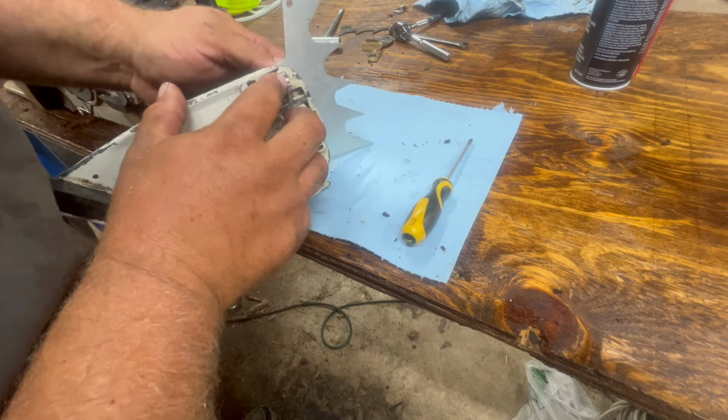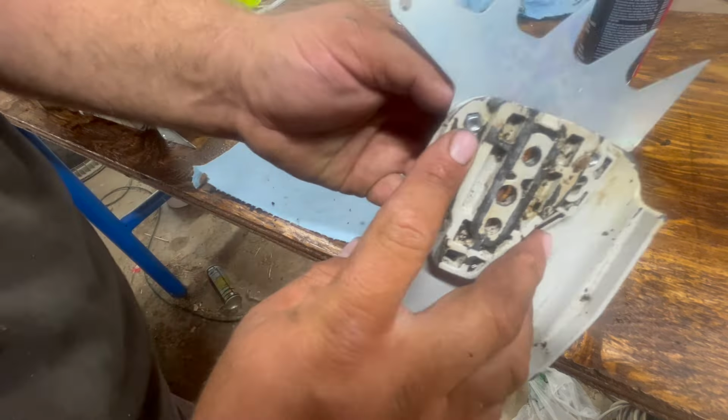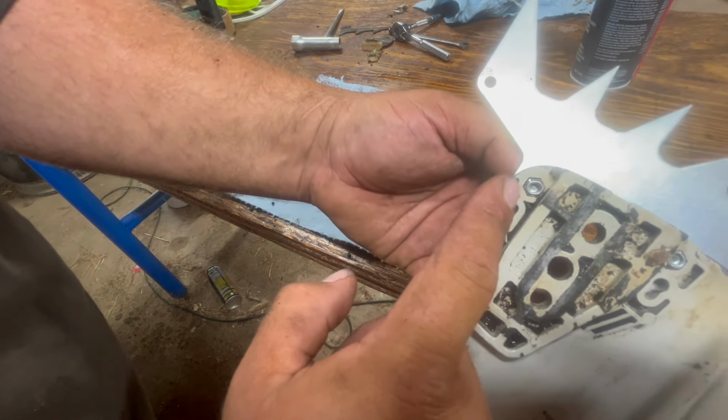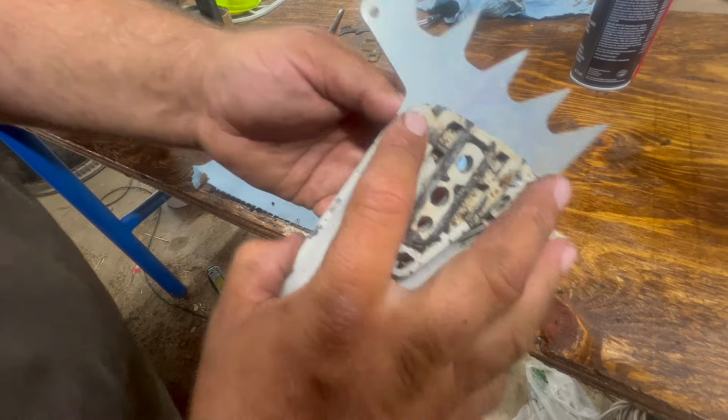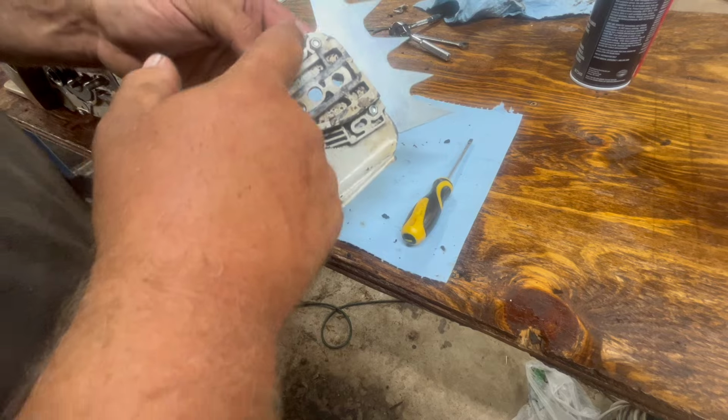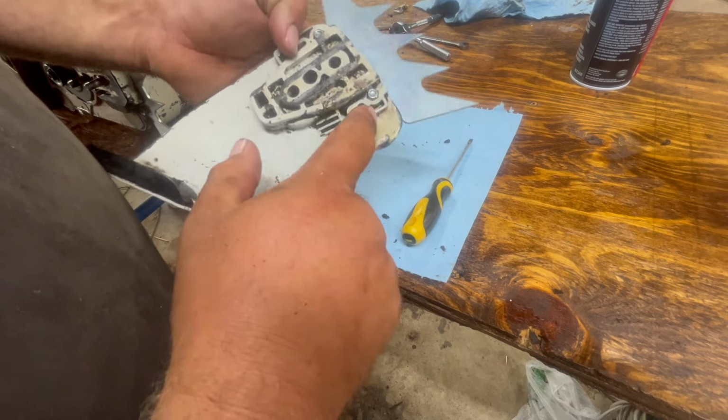And these are lock nuts. You can tell by they're pinch nuts, actually. If you look at the end, they're not round, they're oval, and it'll pinch the bolt. Some of them have plastic, and those are called nylock. These are called pinch nuts.